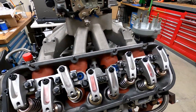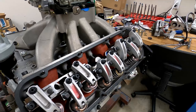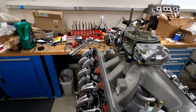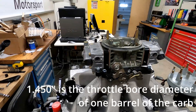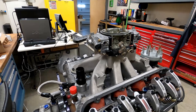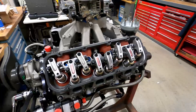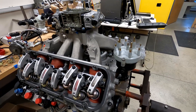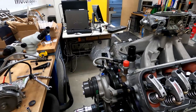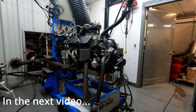There's what a fully assembled Dodge R5 valve train looks like — got both sides done, all valves are lashed. Basically ready to bolt the valve covers on and this thing is done. Got a 1.450-inch throttle bore Stealth carburetor — that's a Stealth-built carburetor, should flow about 1100 CFM. Should make this thing fairly throttle responsive, being that it's just a little bit smaller than what would normally be used on a Cup engine. Basically it's done — got to throw valve covers and spark plug wires on, then mount the alternator, and otherwise this thing is ready to go to the dyno. Let's go!